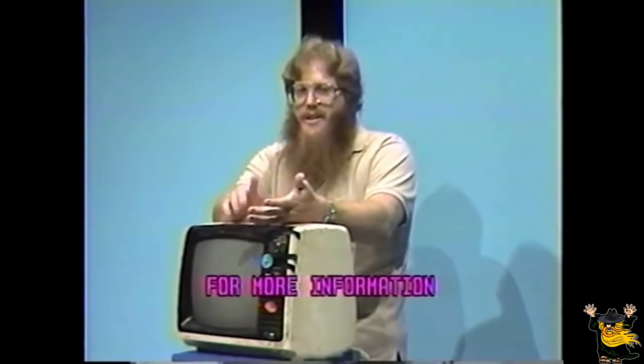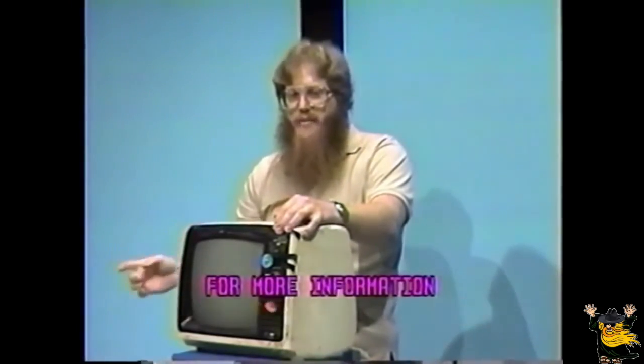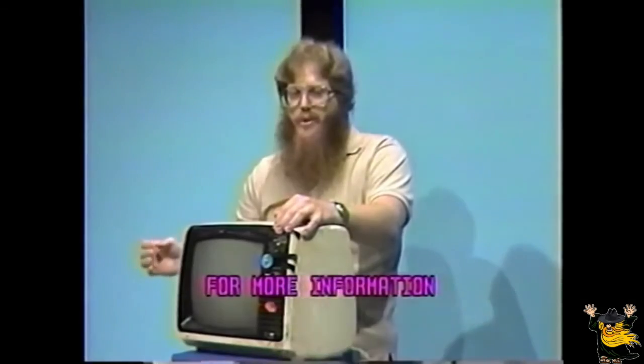We've also gone over those special do's and don'ts, especially that big one of making sure that the computer is the first thing off and the last thing on if we don't have a switch by which we can turn it all off and on at the same time. We've also learned that when we use a cassette recorder, the best place to have the volume control is a little past that halfway point, where on most recorders it'll be 6.